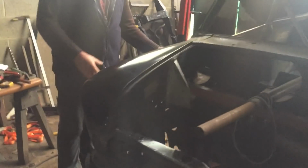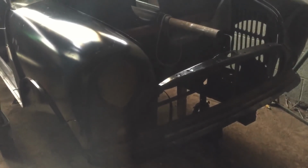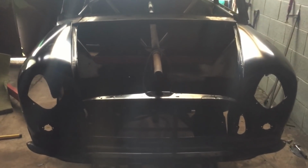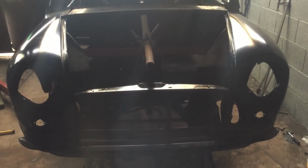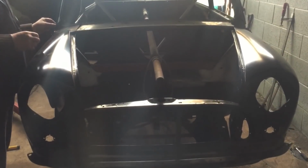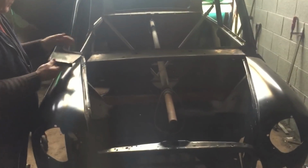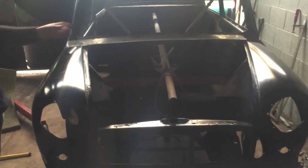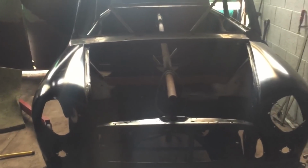I've had to cut a lot of the welds. What we did here. Oh, yeah. To stretch the A panel forward a bit. Okay. And I've had to drop it so it doesn't quite line up, but I might be able to jack the back of the subframe up to twist it a little bit to line up, and I think I'll get a new scuttle. I'll get one sorted out, because we go with a genuine one, because the pattern ones are really poor. Because I haven't got a position, because these have been welded and put in each end. You can't get the line, if you know what I mean. So if I start with a complete scuttle on there, at least I can work off that.